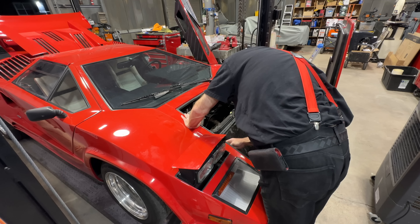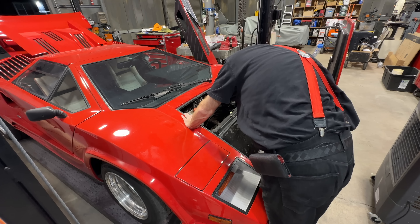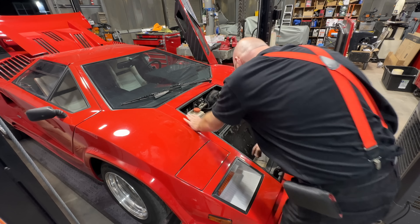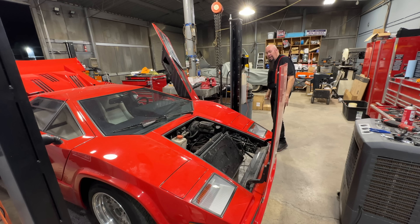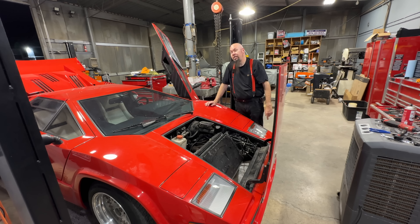This one's working, kind of. This one over here — I put a new relay on it, I cleaned it, the grounds are all good. I'm wondering if this motor isn't bad from the guy that rebuilt it. I really don't want to have to send it back, because that one has been acting goofy.